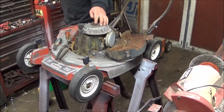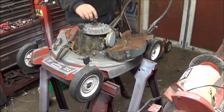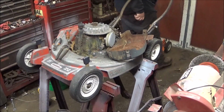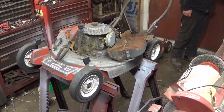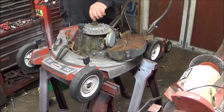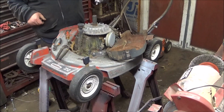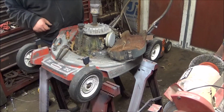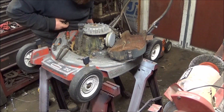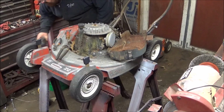That looks like I might have to break out the Ingersoll for that. Which, like I said, guys, the motor's starting to make noise on the Ingersoll Rand. Oh yeah, that's it. The flywheel key is partially sheared too. So, that's alright. I know where another one is.